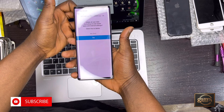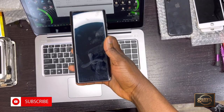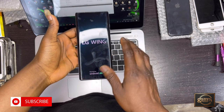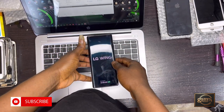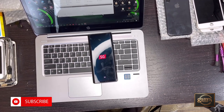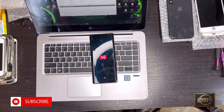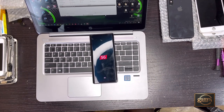Select 'Yes' again to wipe the data. This wipes all user data, including the pattern lock — the security lock on the phone. It wipes everything. Put the phone down and wait until it boots to the setup screen. That is all the steps.